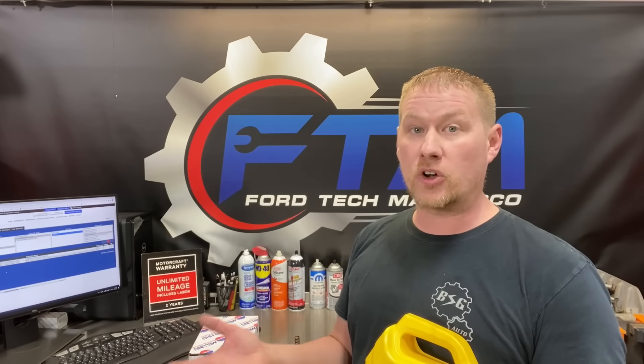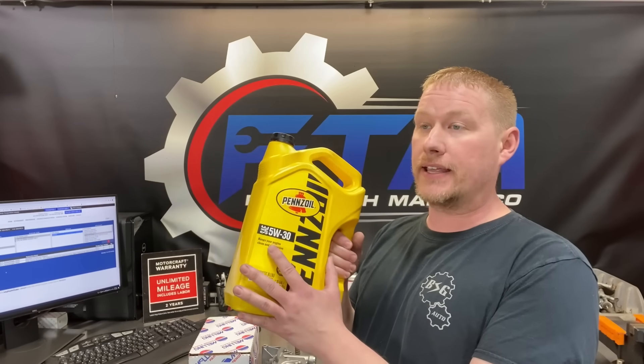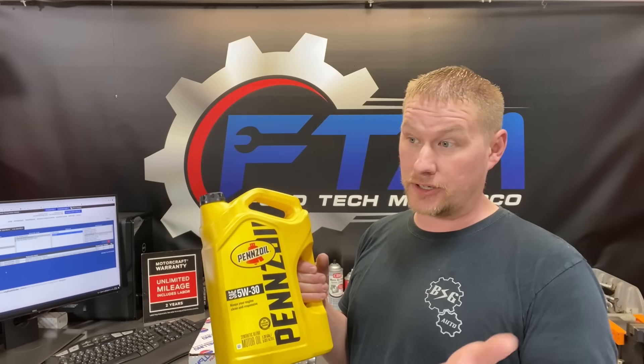The other part of this upgrade ties into the new API oil spec SP, released in May 2020. They had SN for a long time, then SN Plus to address LSPI — low speed pre-ignition issues — and now they have SP. They skipped SO because that name is used in Canada. This new SP oil is specifically designed to address issues with the Ford EcoBoost engines. When testing the oil, the API and oil manufacturers used EcoBoost engines as their test mule, specifically testing chain wear because the older oils weren't protecting enough — a lot of soot and blow-by was getting past the low-friction piston rings and into the oil.